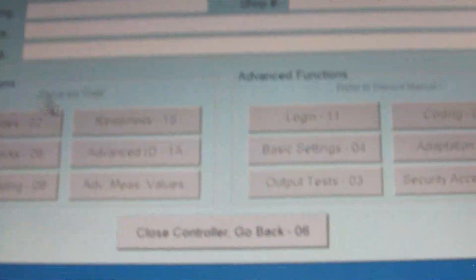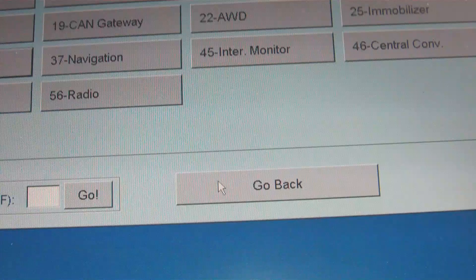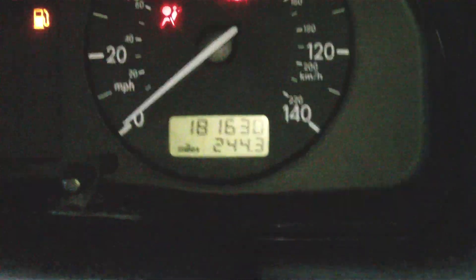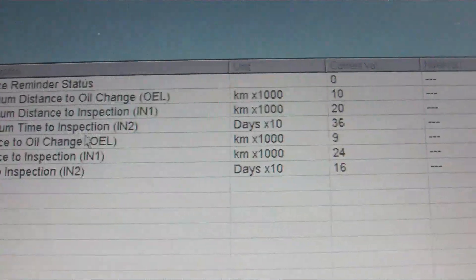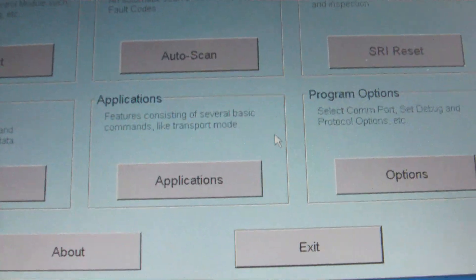At the moment it's measuring my locks, which I've got no functionality on — obviously no response on the controller either. But never mind, we'll exit that. You've also got different things on VCDS: you've got your service reset. So if it flashes INSP down there, it means you need a service — you can basically just reset it straight away, it goes da-ding and resets all your mileage for you. You can change all of them there — oil service inspection and so on.